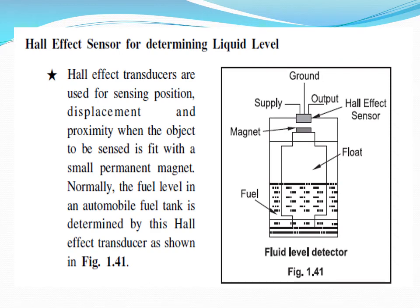Application of Hall effect sensor — it is a fluid level detector. Fuel level monitoring inside an automobile is demonstrated here. It is a fuel tank with a fuel level float. On top of the float there is a magnet and a Hall effect sensor. As the float goes down, it moves away from the magnetic field and there is less effect. As the fuel level goes up, this magnetic field creates a Hall effect, and the Hall effect sensor senses that, allowing identification of the fuel level in an automobile fuel tank.